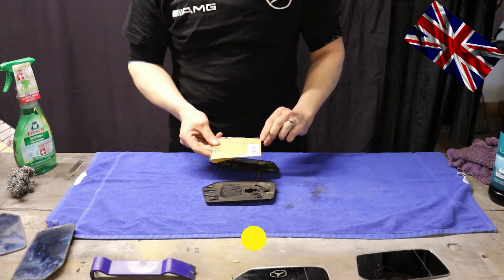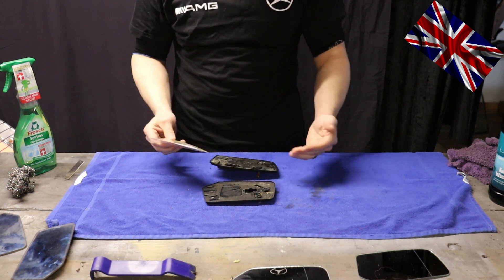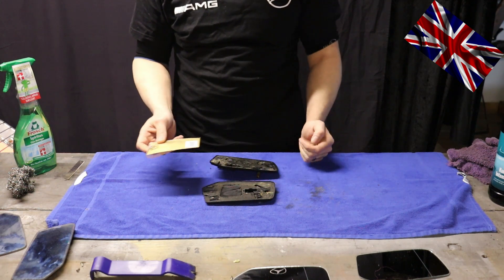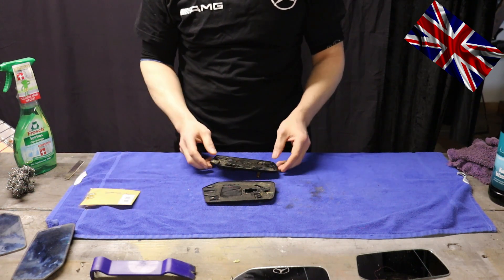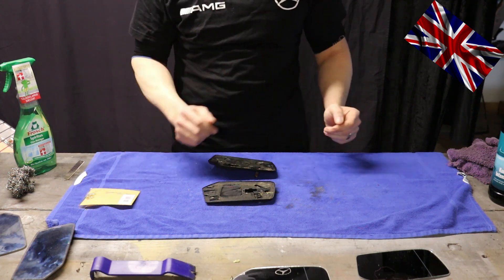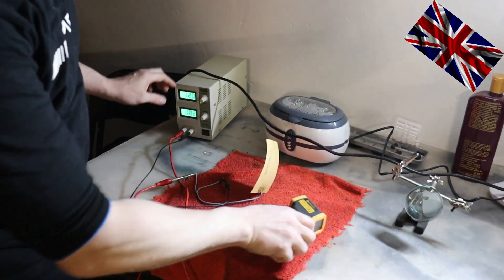The original mirrors were heatable — can you imagine? The plug with the two wires was in this cavity, leading to the inside of the car. As an option, you can buy aftermarket heating pads. This meander is simply glued to the back of your mirror glass and the two contacts need to be soldered to the two wires.